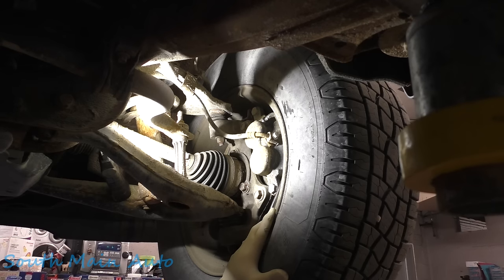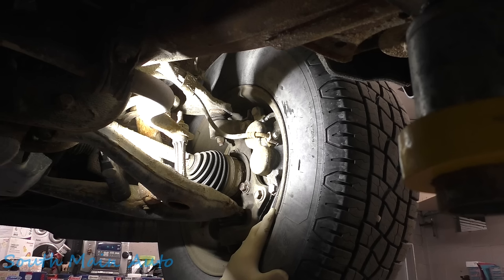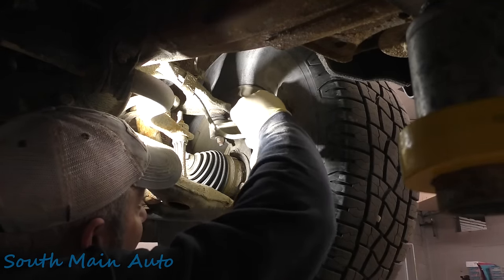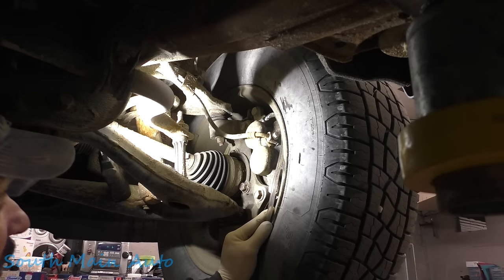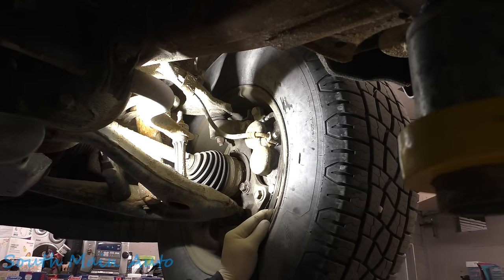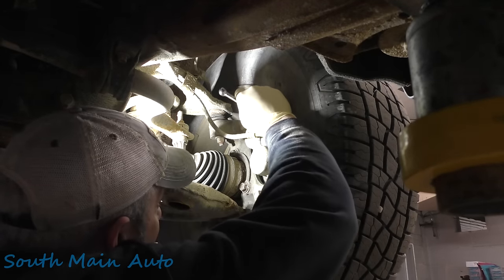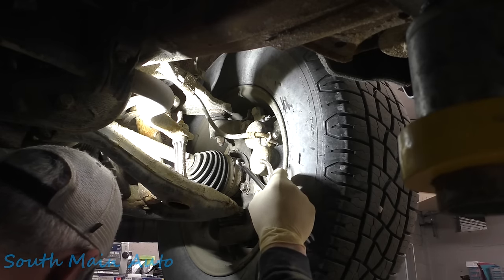Seconds remaining. Four seconds, it says. Pushing out a pretty fair amount of air still. Close the right front bleeder, it says. There's still some air coming out, so I'm going to leave it open for a second. Oh, it might be air sucking around our tube. Fluid's still a little bit foamy. I just want to wait till it looks pretty clear, then we'll close it off. All right, that one is closed. Hit continue. Oh, please wait.